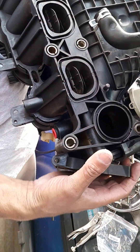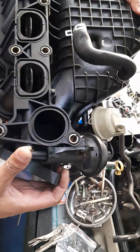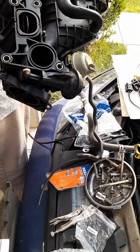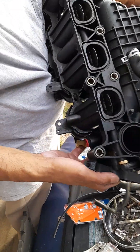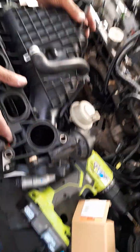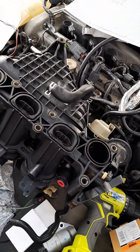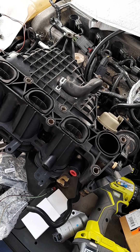I cleaned this manifold up with water - it was filthy - using carb cleaner. Pulling these dampers for open and close is like heating and air conditioning - you've got dampers that use vacuum, same principle. The crazy glue keeps the damper piece and the hose line in place. I go to the junkyard regularly and collect parts, nuts, bolts - everything, because you need it. Share this information with people so they know what to do when they run into a situation like breaking off the screw from the MAP sensor.